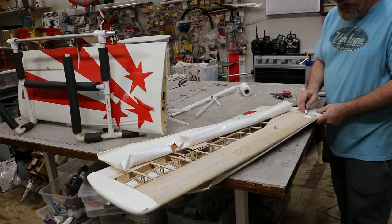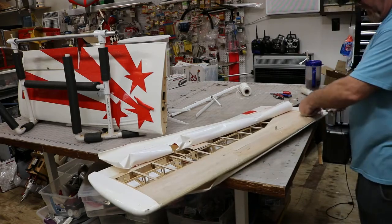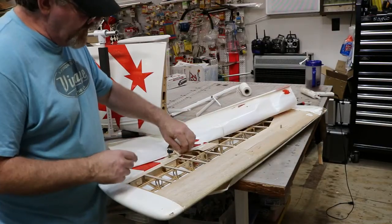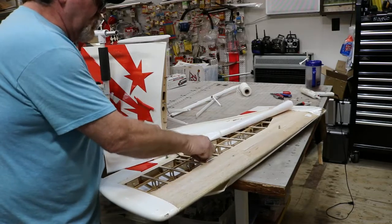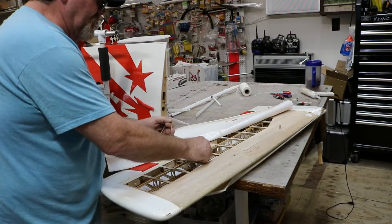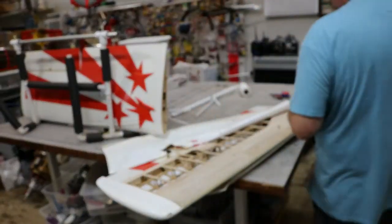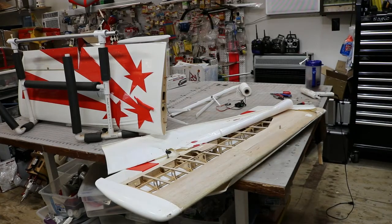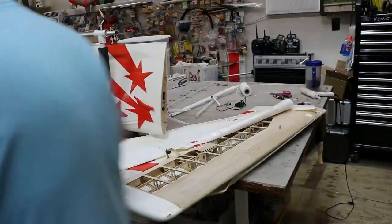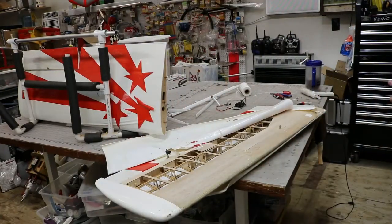You see, you'll get this here. So, I believe, and I always get it wrong, one of them has the color in the glue, and the other one, the color is in the actual plastic. So when you go to take this apart, depending on how much heat it is, sometimes it'll leave a lot of that color behind, and that can be very problematic for a recover unless you're going darker color. A darker color, it's not as bad simply because it won't show through. But if you have like a dark red and then you want to go with a white, you forget it, it's going to show through.